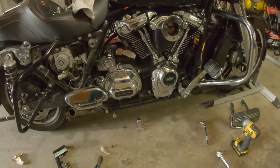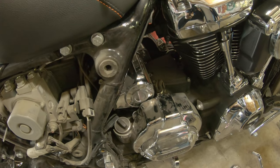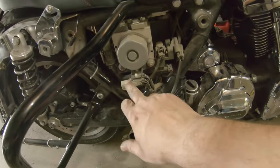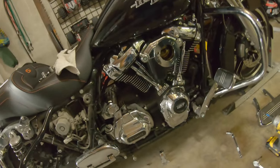Okay, we're back. I went ahead and got the main pipe off. I did have this little nightmare piece from Kiryakin — that's not going back on because it really interferes with the O2 cord. I don't know if Kiryakin designed it this way, but that piece is dangerous, so it's gonna stay off. I don't recommend it — it's overpriced, it doesn't fit right. It looks decent when it's on there but it's not worth the potential headache of screwing up an O2 sensor. As you can see, I was able to keep the crossover on and freed up the O2 sensors — this is the front plug, and the black one here is for the rear O2 sensor.